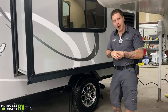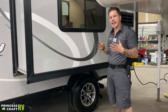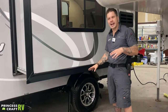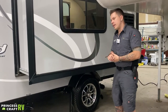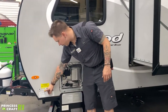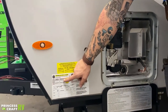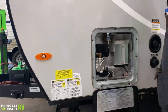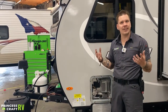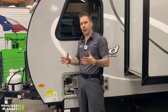For tire pressure on any trailer tire, run at the max tire pressure rating stamped on the sidewall — it is also listed on the data tag on the unit. With these particular tires, run them at 65 PSI. That's the max tire pressure rating, giving you the highest flexibility in weight rating whether the unit is completely full or completely empty.